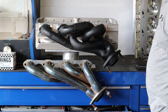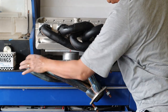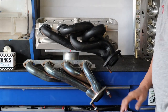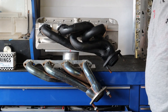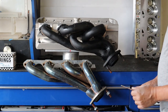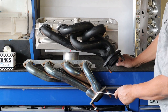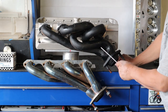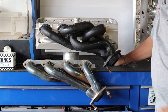Here we go — you're looking at a header system. There are what you call shorty headers. The factory looks similar except the flanges are crimped up really bad and the pipe is a little smaller — about one and a half inch. This is an inch and three-quarter BBK unequal-length shorty header, cut here instead of all the way down to the collector. An equal-length header has a little bit more power than a standard shorty header.